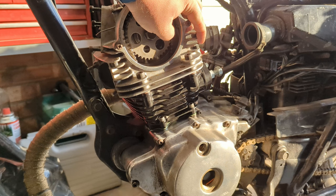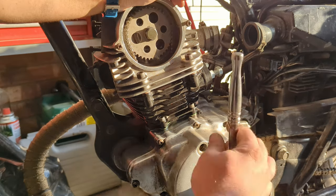We can pop our thumb over the spark plug hole to make sure we're making compression. Essentially, it's just a not so dry run, but a run without the risk of starting, just to make sure that everything stays where it's supposed to when the engine's moving at a couple of hundred RPM instead of, you know, two by hand.